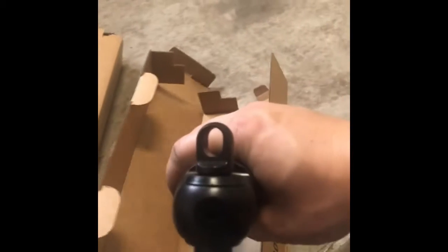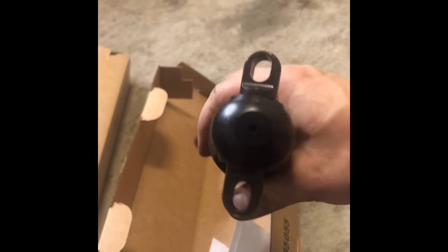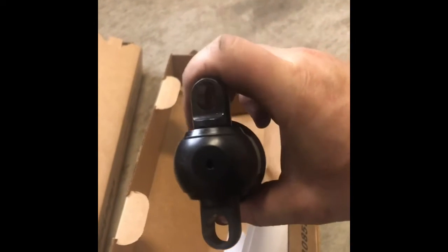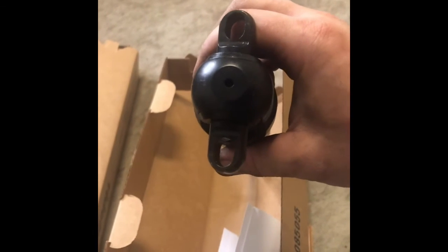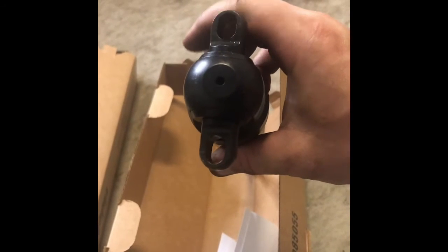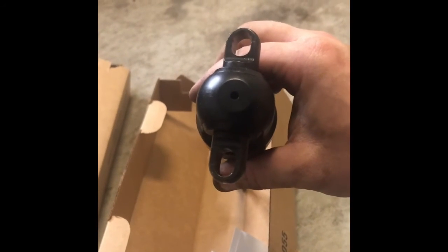The other note I'll make, let's go look at this one that's sitting over here, is you can see on the KYB, it has open slots here, and the head of the bolt was pushed all the way to the outside. And with the Ridetech, they have these slotted holes like this, and it's really tight to get the bolts in. The bolt hole spread, it'd be nice if this was just a little bit wider. So I actually think I might take a porting die grinder bit to just open these up a little bit further to give me a little bit more room to get those in there. But that's it. Time to get this one in.